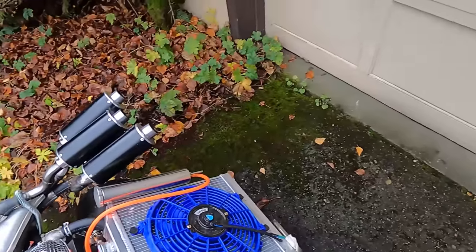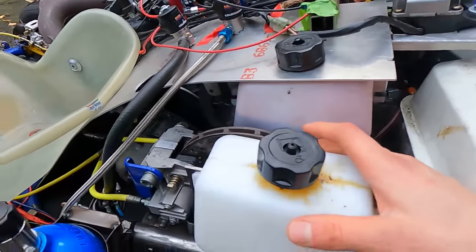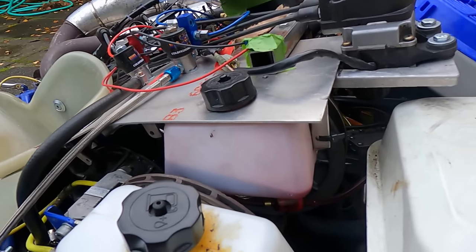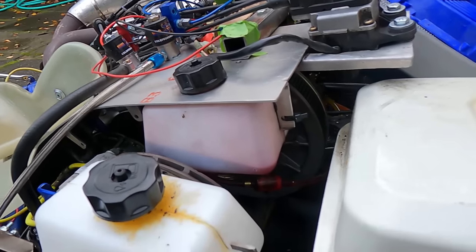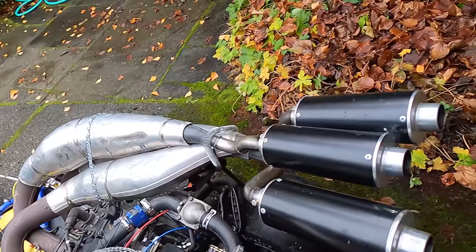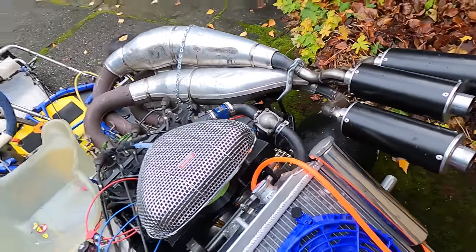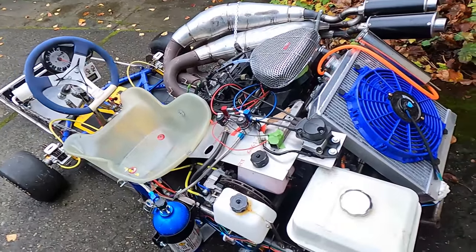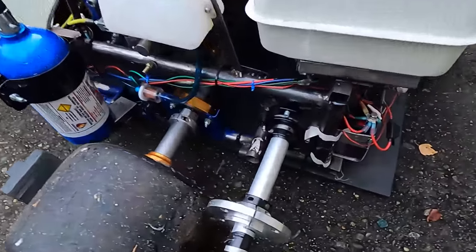Running back — the brake is on the jack shaft. This provides a little mechanical advantage, although you do have one issue: if you break a chain, you'll lose braking. However, you still got the front brakes. Also running a 50 motorcycle chain, like a 530 — this thing is beefy, and as long as you're up on maintenance and not neglecting it, I don't think it's going to break.